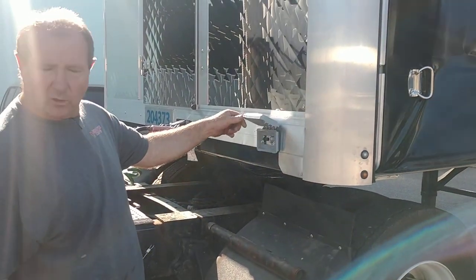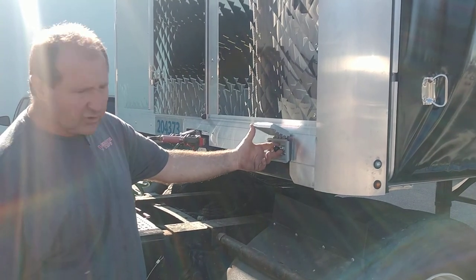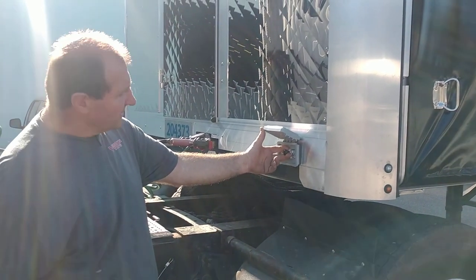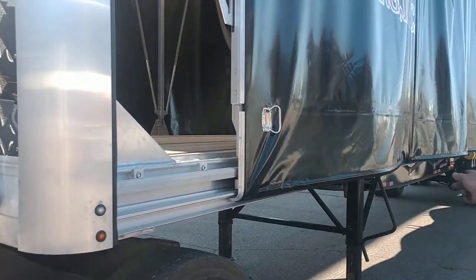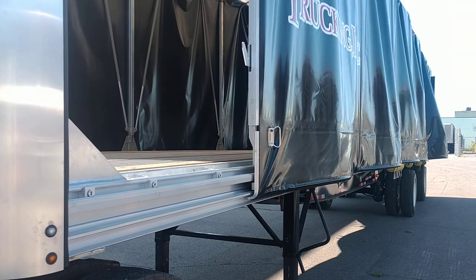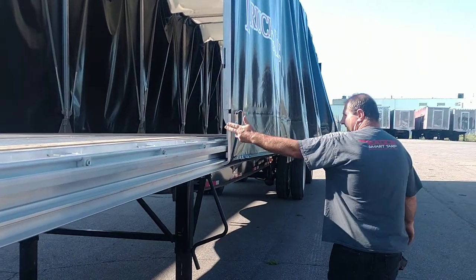At the front here is where we normally keep our front unlocking for the air block. It's that three-position valve — just pull it out all the way. Once it's released, because it's downhill, you'll see it already opens itself. Partially anyway. If you want to give it a hand, feel free.